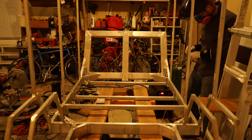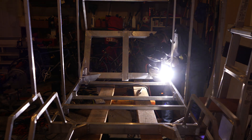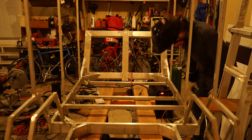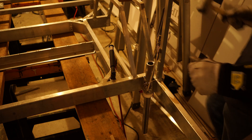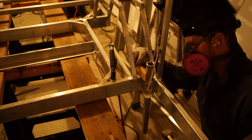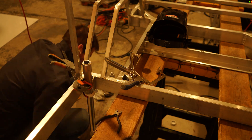I did quite a bit of research to determine where I wanted to place these stabilizer legs. Ultimately bringing them on the inside I thought was the most elegant design — out of sight and doesn't take much interior room once I box it in with insulation. Going custom also allowed me to go with some real thick stock, so I know it's gonna be strong and I'm not gonna have to worry about bending the legs. These are really robust thick aluminum tubes.